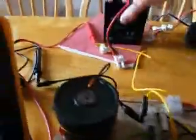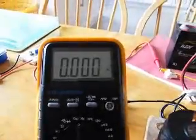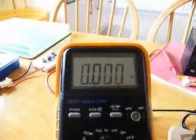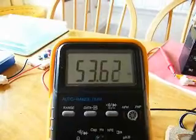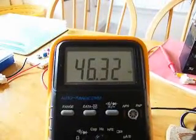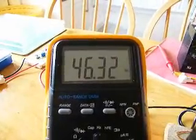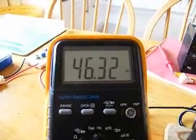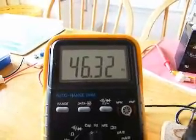I'll just switch it off. Switch it off — we've got a flat battery again. Switch it back on and there we go, it keeps dropping. It'll just maintain the voltage at around 14.5 volts, right down to 4 hertz or so. Usually it stops at about 16 hertz and just trickles the battery.